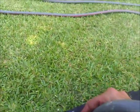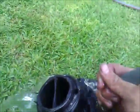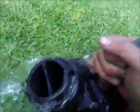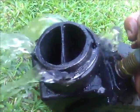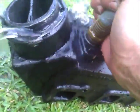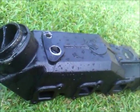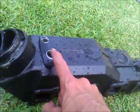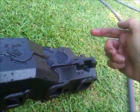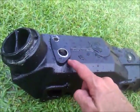That's how I knew something was wrong with mine — it would pressure up and come off. That's without a gasket and it has great flow through there. It's not back-pressuring up too much. What was happening is the old one was back-pressuring and blowing off — blowing off the tube that went to the engine, actually back-pressuring and blowing it off the heat exchanger.